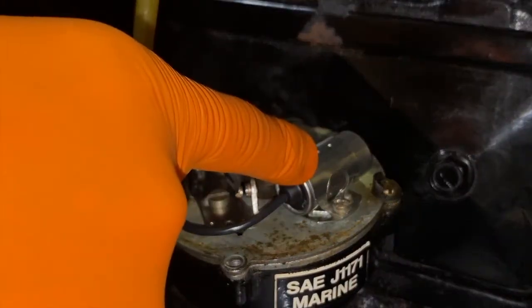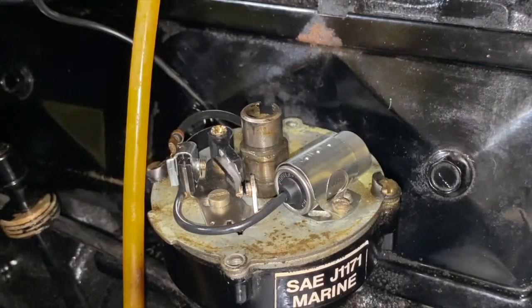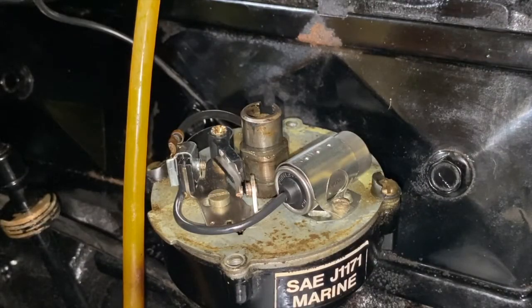DIYers, this is extremely important: if you've got too large of a gap or too small of a gap, your engine will actually run worse than it did before you replaced everything. So loosen up the screw, come in with the feeler. If that point gap is not properly set when you install your brand new tune-up kit, it is very likely that this point right here is not creating an electrical spark, which in return is not sending that electrical current upward into the rotor and inside the distributor cap as it spins — which ultimately leads to your spark plugs never actually getting spark or ignition from the system. So you can keep cranking your engine with no success of ever starting.